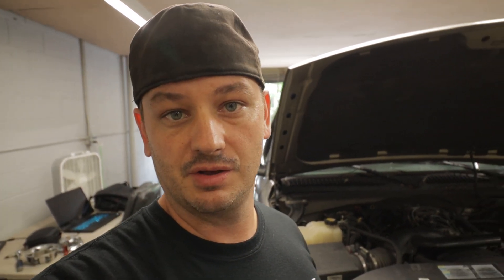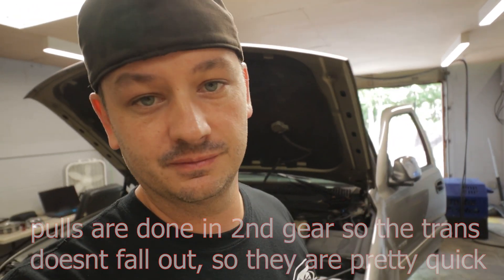We're going to make some runs with all of the factory knock retard capability disabled, so it's not going to pull any timing. Our dyno is designed to handle between three and four thousand horsepower, so when we put these low 200–250 horsepower cars on here they read very low. To put it into perspective, a car that makes 230–240 on my old Dynojet 248 will usually make about 180–195 on this dyno. So expect the numbers to be a little bit lower. I'm fully aware this thing is a big gigantic turd, and the fact that it's willing to take so much timing really shows how much of a turd it is. Results here are abnormal, so definitely don't just plug these numbers into your car. I'm sitting here with headphones on, monitoring multiple things, and I'm perfectly okay if this motor blows up.